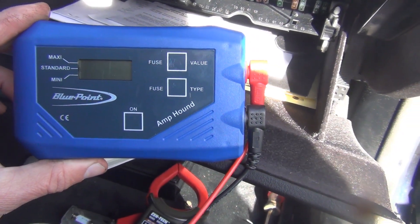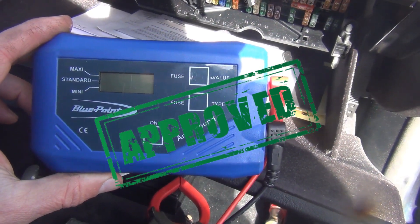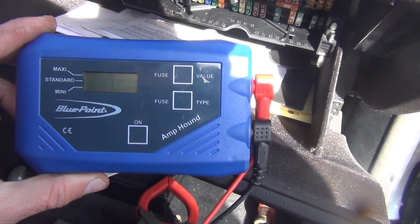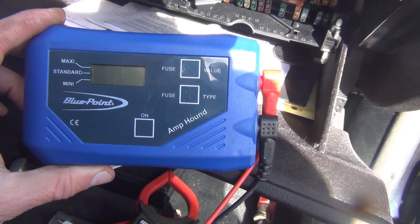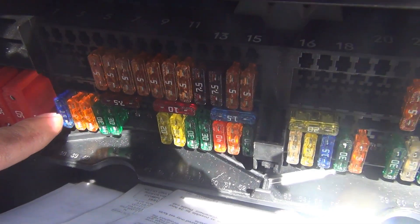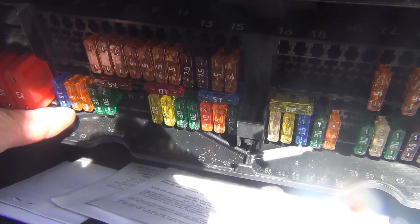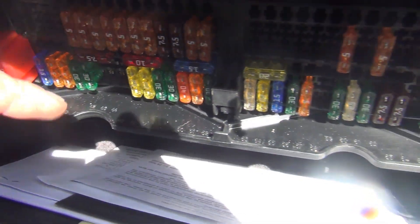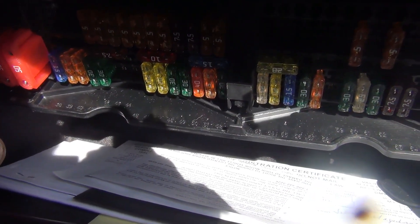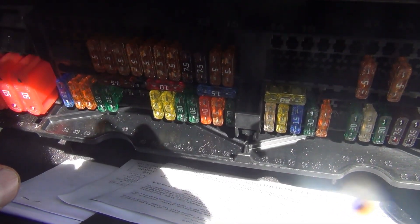What this really cool tool does is it measures voltage drop across the fuse terminals and it can then determine what the drain is in amperage across the fuse. It does that by the resistance of the fuse — it knows the resistance by being able to determine how much resistance there is in, say, a 15 amp regular fuse, a 50 amp maxi fuse, or the smaller mini fuses. You dial that into the amp probe, then measure across the terminals and it will tell you what the actual drain is on that circuit.